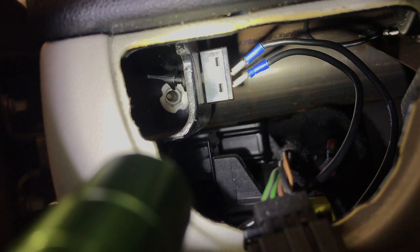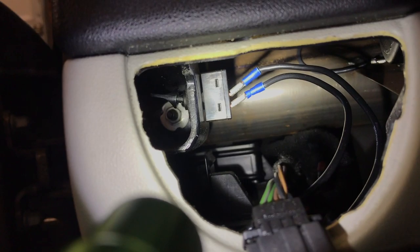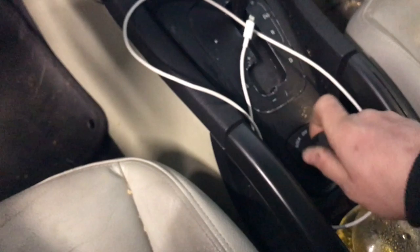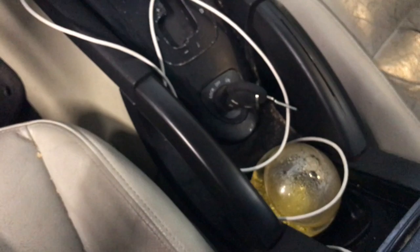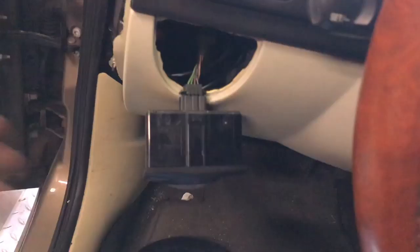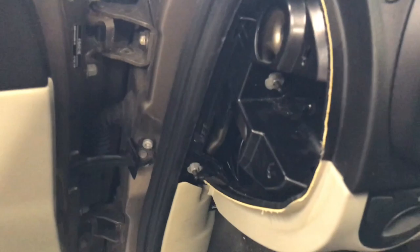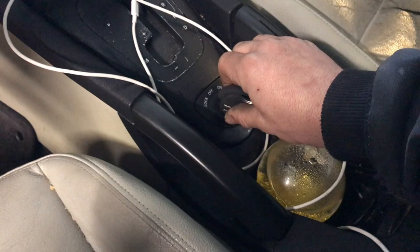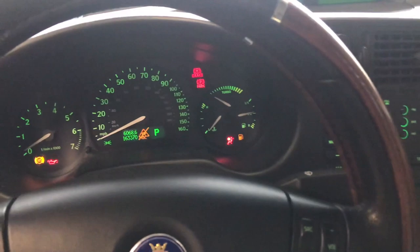If you look behind here you can see where I've mounted the little switch — I just drilled a small hole right through this piece of plastic and mounted it there. What this switch does is cut the power to that column module. If you ever have the problem, you can simulate a battery disconnect, which resets the module, by flipping the switch off. You could even use this as a little anti-theft mechanism and put the switch wherever you want. After about 15 to 30 seconds, flip the switch back on, give it another 10 to 15 seconds to power up, place the key into the ignition once for a few seconds, remove the key, put the key back in, and start the car.